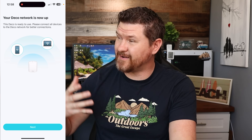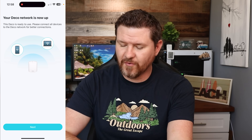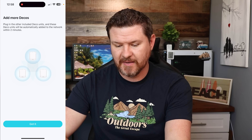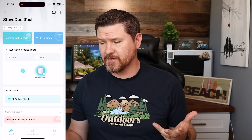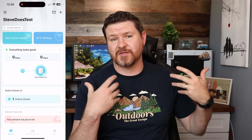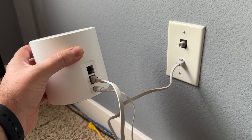I know this can be intimidating for a lot of people — you think you have to set up a home network and you know nothing about that. But hopefully in this example you can see how easy it is. It says do you want to add more Decos? I've got two more to add because this is a three-pack. We're just going to get those connected, plugged in, and then we can put these around the house. That is what I love about a mesh system. Essentially we're going to take these devices and put them around our house — they do connect wirelessly to each other. But what I like about these is they have an option for something called a backhaul. If you do have network cables running to each room of your house, you can actually plug those into the network ports on the wall and into the switch, and it's going to make your Wi-Fi even faster.